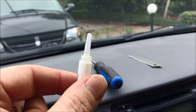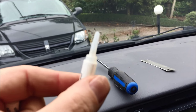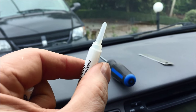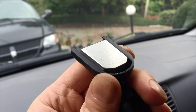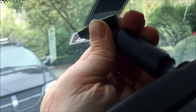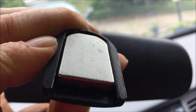The adhesive has a twist-off cap. I was using an X-Acto knife to scrape the windshield, and luckily this tube has a little top you need to slice off — so do that. Squeeze the tube to get the adhesive out and put a nice bead right on the rearview mirror fitting. Before gluing the metal fitting, make sure you know which direction it fits onto the windshield — it would be very bad to glue it upside down. My Corolla's cut-out shape matches the actual metal fitting, which helps.